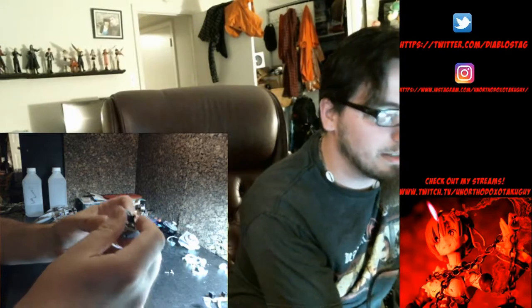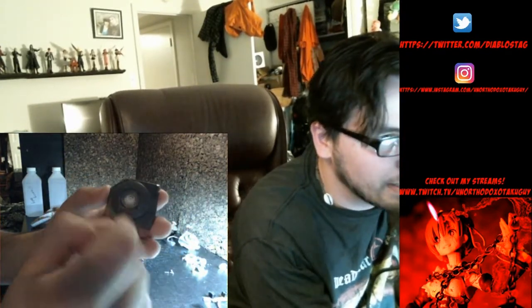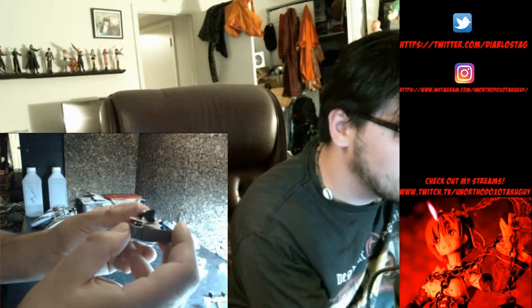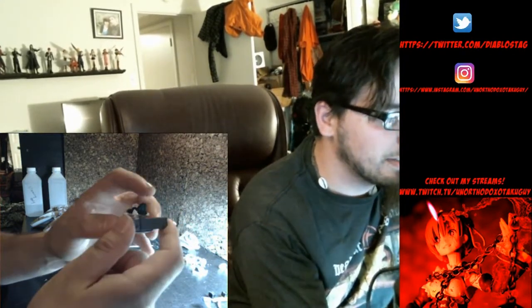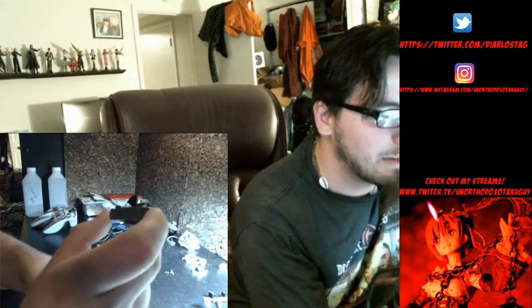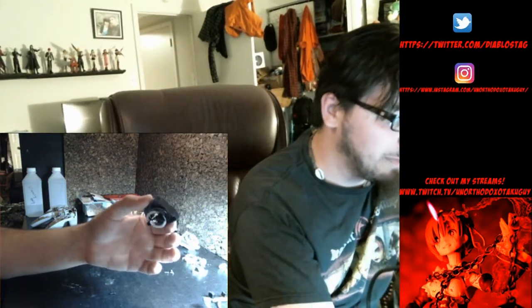You'll see it holds the control stick in. It's going to sit in the cradle there. The spring's going to want to keep it taut in place and have the gear. So this flat part is technically the back of the control stick. Have the gear towards the back, and you'll line it up straight with it. That's the easiest way to remember when you're working on it, because when you go to drop this in, that will be the back part.